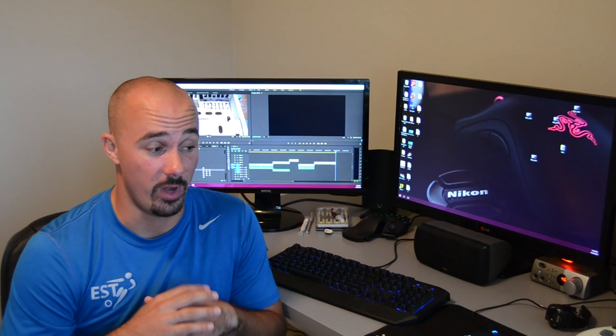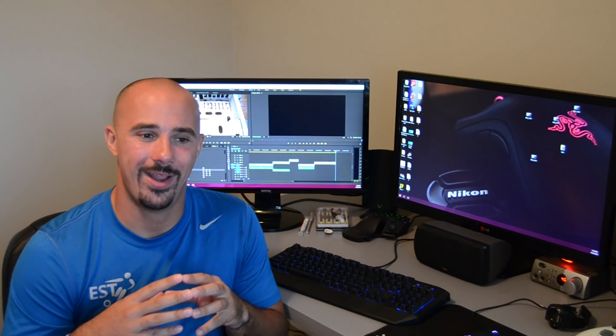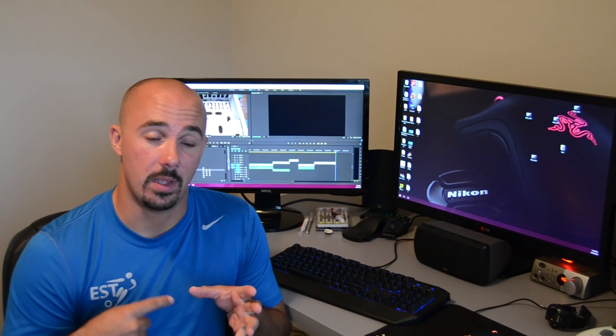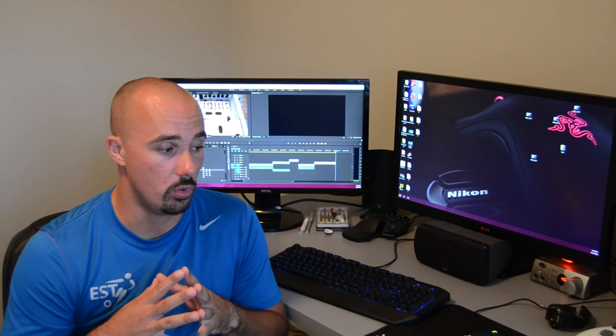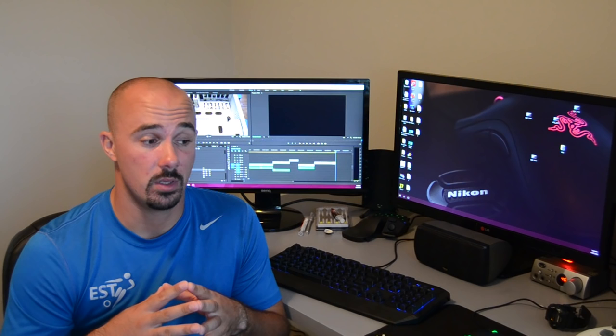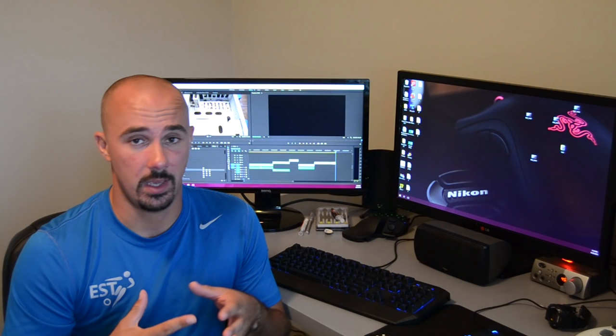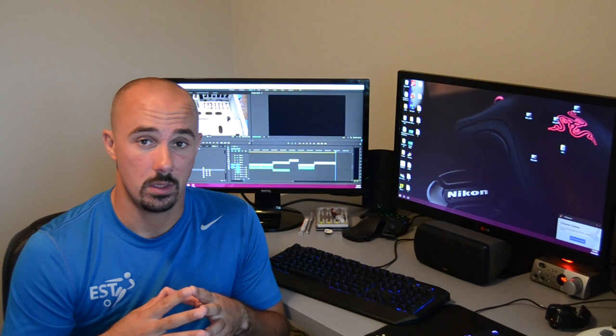However, I did come into one small problem. When applying the thermal paste, I didn't think I applied enough, so I had to take off the CPU block, wipe it clean, and add some more CPU thermal paste. But now it's running pretty cool. I applied new thermal paste to the GPU as well, and it's running a couple of degrees cooler. So I actually recommend people who have a little bit of knowledge in taking GPUs apart and putting thermal paste on the GPUs and onto CPUs, redo your thermal paste, because I feel like you get a slight improvement in your degrees Celsius.